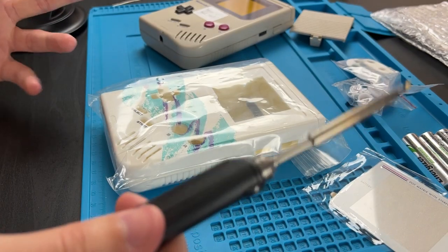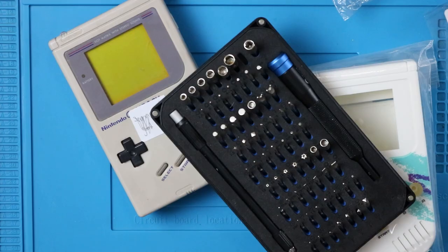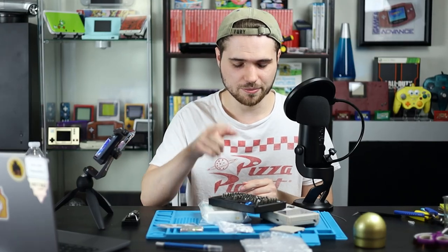So if you are trimming, you're gonna need this. Unless you don't want sound, you're gonna need a soldering iron. You're gonna want some sort of screwdriver kit. I use the iFixit one because it's got everything I need. Not sponsored, still wish I was, hit me up. I can make a mean ad or a good ad, not mean. But you're gonna need a tri-wing and a Phillips head. Technically JIS, I say that every time. Phillips will work just fine, just be a little more careful.